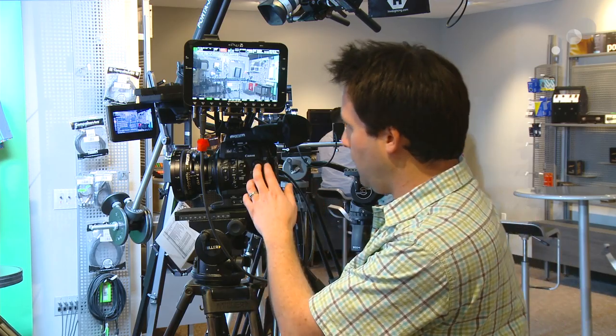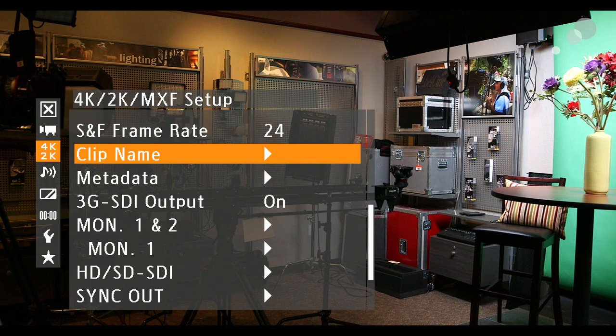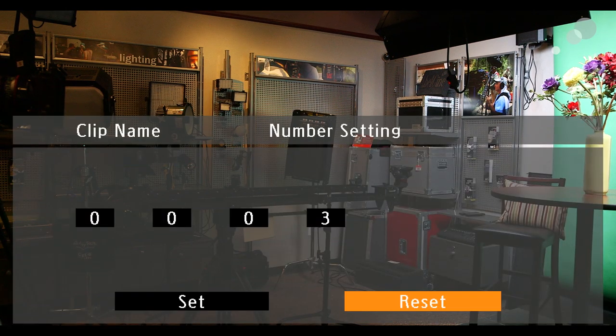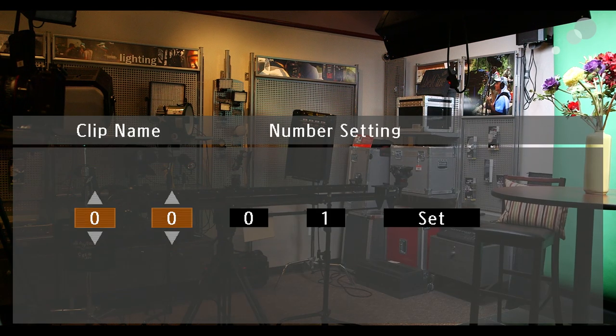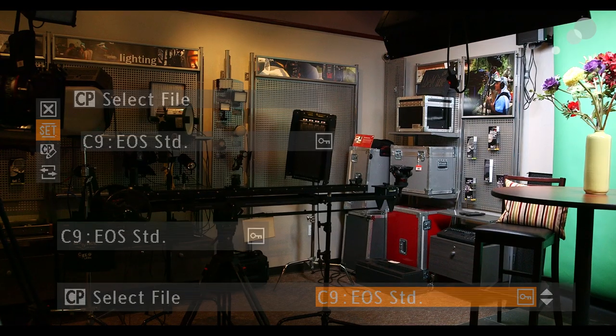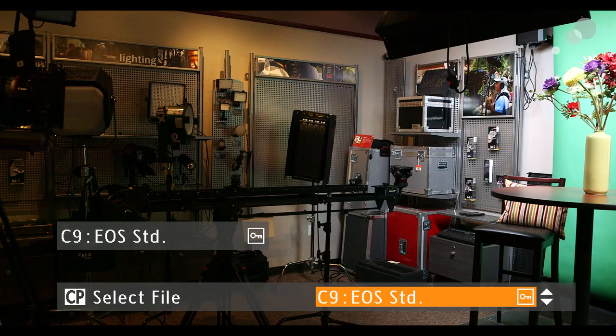Internally we may choose to also apply a LUT. Back in the camera, let's set the file name for the internal recording, which will be matched on the external recorder. Go back to the 4K 2K area and go down to Clip Name. Go ahead and set a clip name — I'll do AB for Able. The number setting is incremented every time you roll, so set that to 0001. That is my file name. Now internally I may also want to apply a LUT to make the internal recorded image look good. I can do that by applying a custom profile or scene file. The nice thing about this camera is you can work with scene files internally just as you would on a C300 or C100, but still get that clean raw data out. I'll go ahead and select EOS Standard — that's my internal LUT and it does not affect the external recording at all.